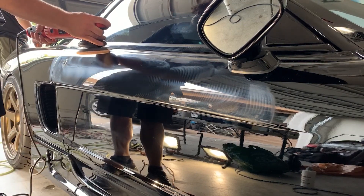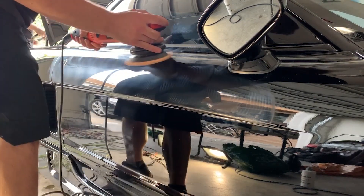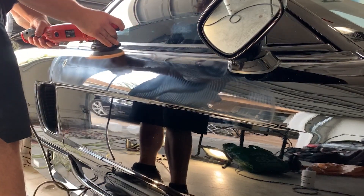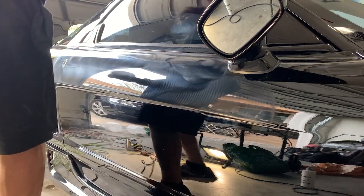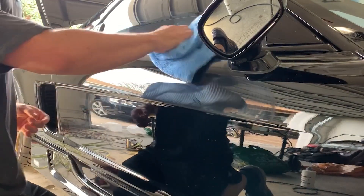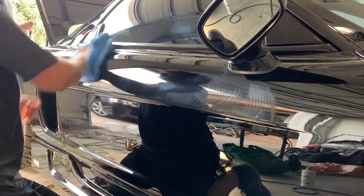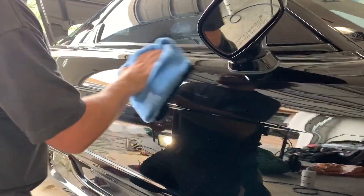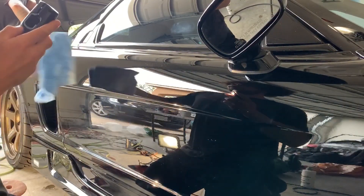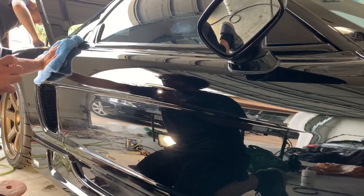This car takes quite some time to break down all the polish, especially using a 5-inch machine at slow speed — you've really got to work it in and take your time. Final polish is usually more important than the compounding stage, because that's when you're really refining the finish, working out any little tick marks or haze. So it's important to make sure you also did your compounding step correctly and broke down all the product.